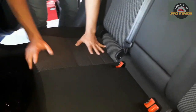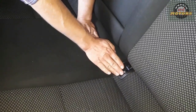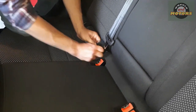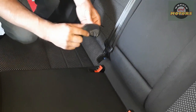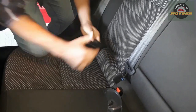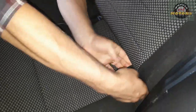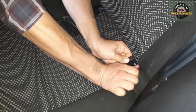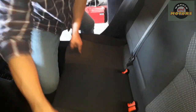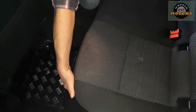First we need to remove the rear bench seat. Pull the Isofix out — sometimes there are little plastic covers here, so take those covers out and then pull this out. They have a curve here so you can just take it out — those are the Isofix plastic fixings. Next, there are two clips here approximately, so grab the seat and forcefully push it up.